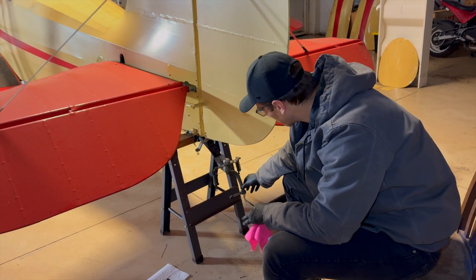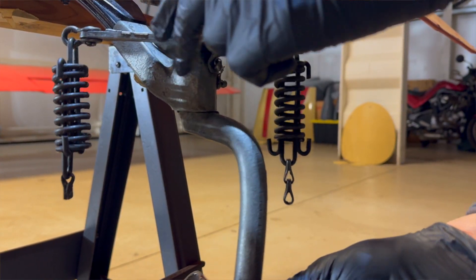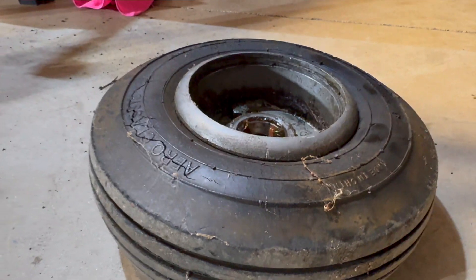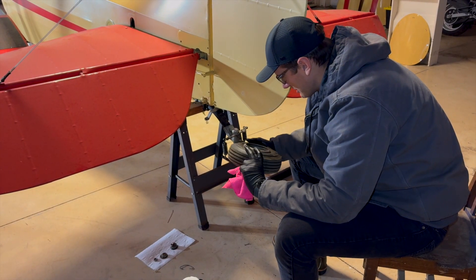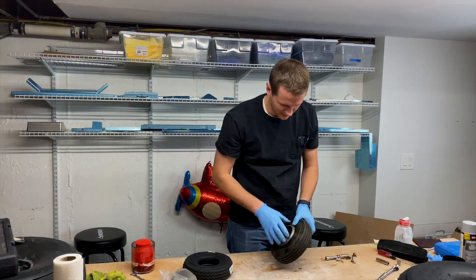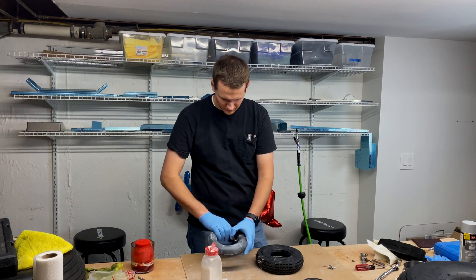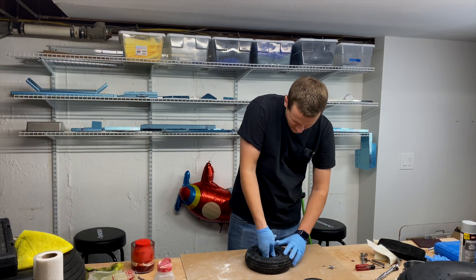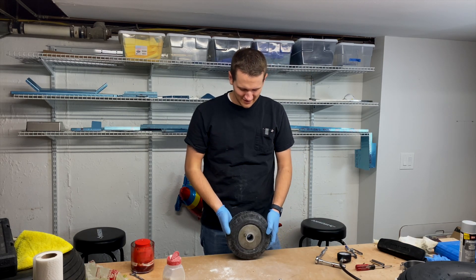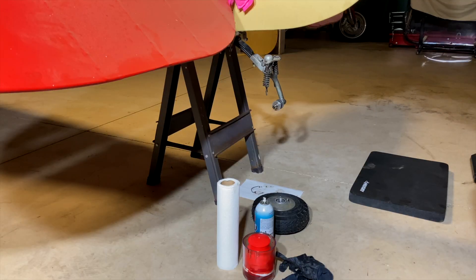As far as the tailwheel is concerned: it's greased, checked, and serviced. It brakes freely and locks nicely. We need a new tire and clips, then we'll pull this apart. Tire number three — we've got our tailwheel, we're going to split the rim, clean it up, put the new tube and tire on, seal it back up. Third tire done — the most fun one for the tailwheel portion — and we're done.